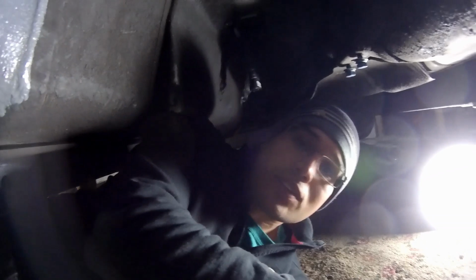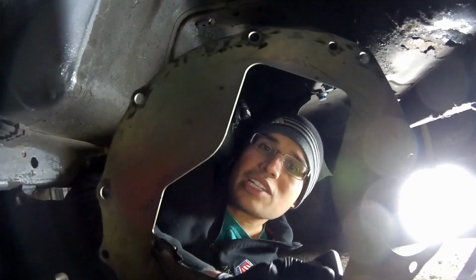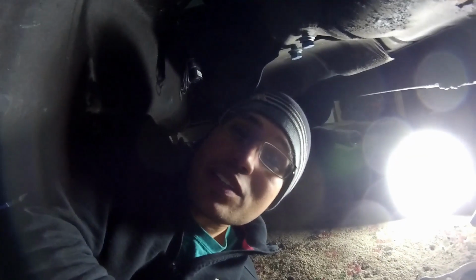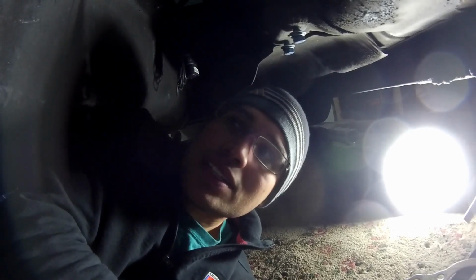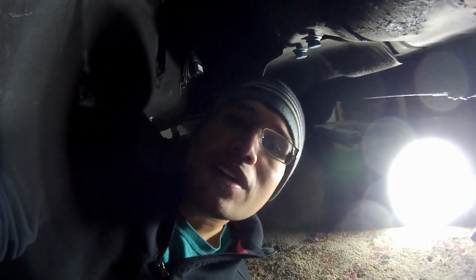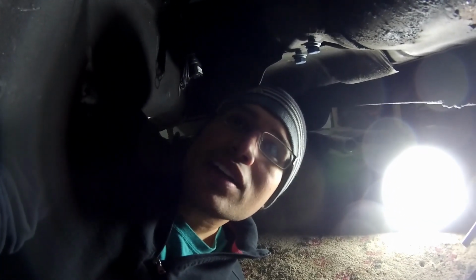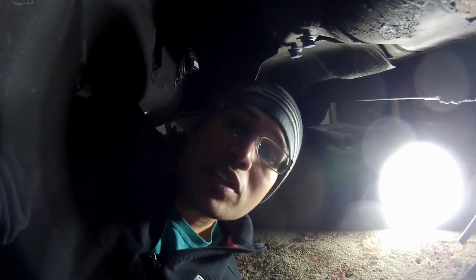After that, don't forget to put on your spacer plate between the engine and the transmission. Because if you forget to and you put your flywheel and your clutch on, you gotta take it all back off and put it on. So don't forget that part. Ask me how I know. Yeah, done it. Alright, we'll set the plate up there, and then I'll throw the flywheel up, bolt it on, and then we'll go with the clutch.